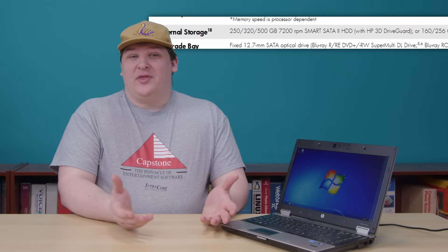7,200 RPM hard drives were pretty common in laptops. That's what this shipped with, and you could even order it with an SSD, and I'm positive that would have improved boot times even after Enterprise IT got their hands on it, so no exotic solution was needed to make this machine usable. I think it was fine as is — it's just that someone at HP wanted to earn a bonus that year, a topic we'll come back to much later. You were unequivocally better off just using Windows or even Linux, because at this point both of them fully supported Standby and Hibernate, and they could resume faster than even QuickWeb could boot.